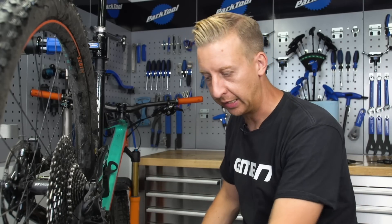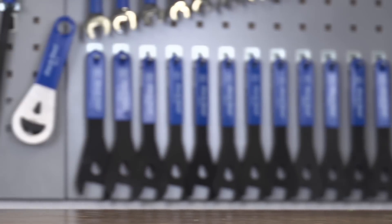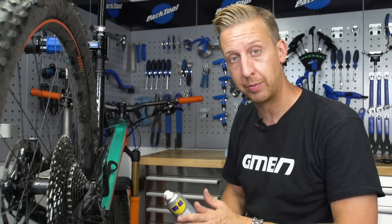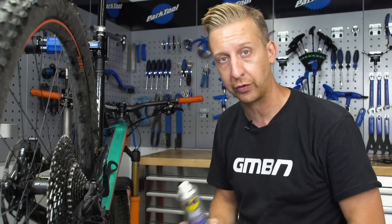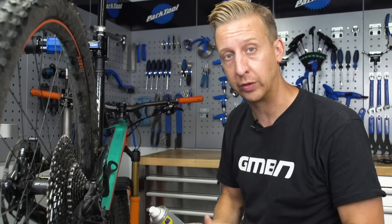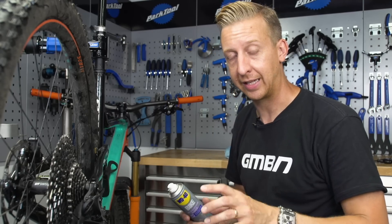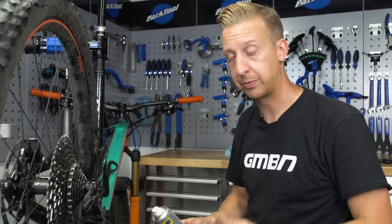With the chain fully clean it's running nice and smoothly. The only thing left to do is of course lubricate it. Now you've got a few options here, and this does depend on where you're riding and the time of year. In the UK I tend to have a dry lube and a wet lube and also a spray lube for various different reasons. If I'm on a day out with my bike in the back of the car, I'll carry a spray lube with me because I can run it through the whole transmission and it also acts as a bit of a water displacer, so it's a kind of multi-use product. However, it's not as sparing as using a dedicated chain lube so you're going to use more of it by just spraying it on.